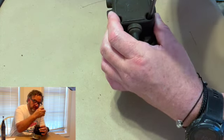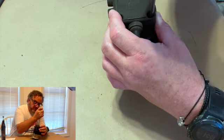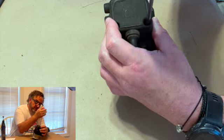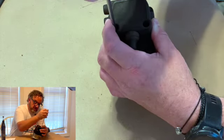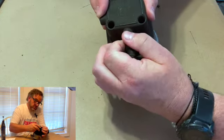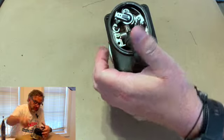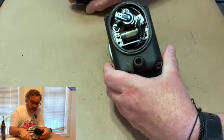And basically, that's what happens inside this box. And even when it says have a magnet moving, you can actually move the wire as well. Because if you look on some old magnetos, I mean like brass era, 1905, 1915, that kind of thing, the magnet didn't move, but they moved the wire, which was inside the armature. And I'll show you what I'm talking about when I say armature.